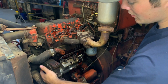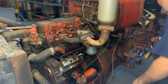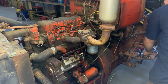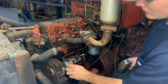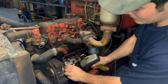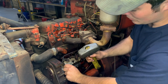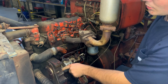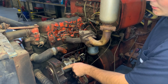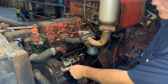So now we've got to disconnect this drive gear and then we can unbolt the pump from the housing. But first, a very important step here is to mark your timing. You're going to take a small pointed punch, line it up on your housing right against your front cover, and give it a good tap with a hammer. You want to create a punch mark that hits both your front cover and your housing, to give you a reference for your timing when you put this pump back on the engine.